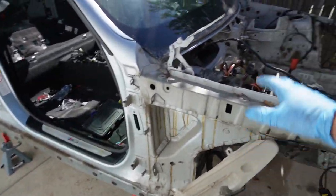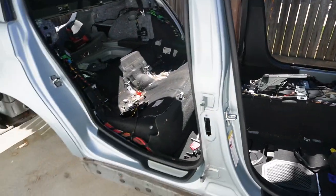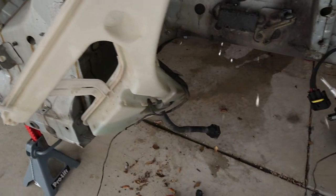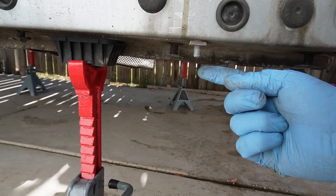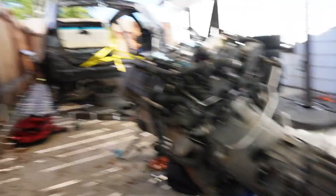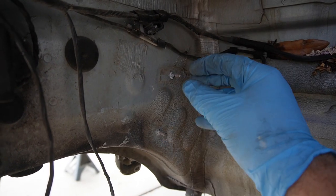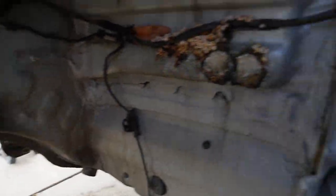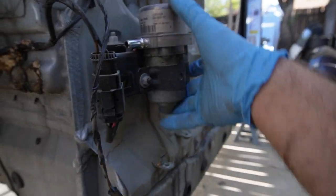After a few hours, we have pretty much every single panel removed off this car — both fenders, the hood, both side skirts, all four doors, the rear bumper, and the trunk. We've made some serious progress. Now we can start moving things over — all the piping, little brackets. We'll have to de-weld and re-weld some brackets, for example this piece that holds the M3 fender, since normal 328s and 335s don't have it. For the brake lines, someone from the builds community sent me a link to weld-on fittings we can install on the E91 to route brake lines OEM-style, which is going to look really nice.